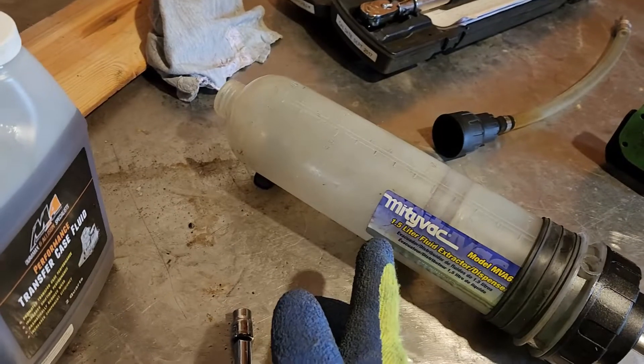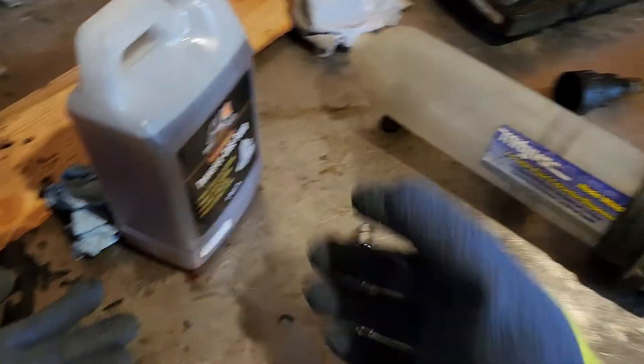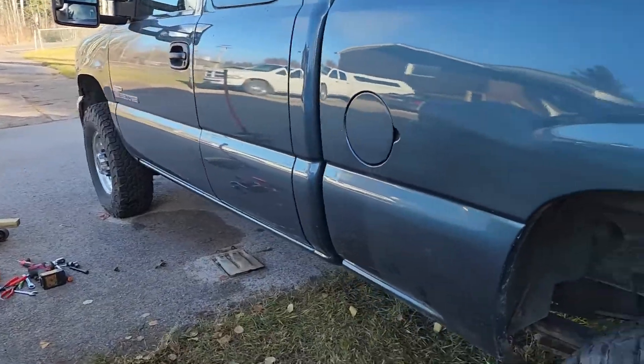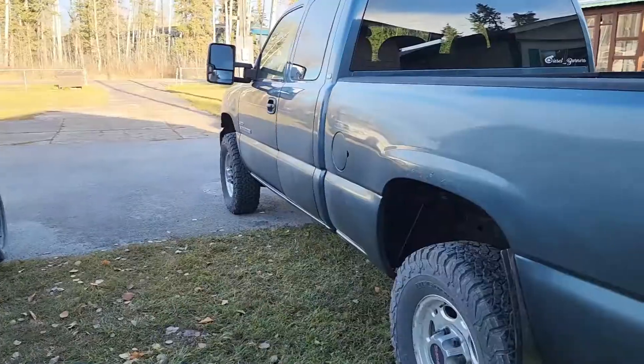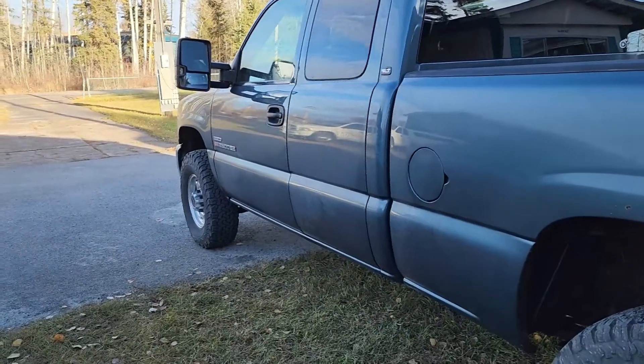I'm filling up the mighty vac - it's pretty handy for tight spots like this, you just put it on the end and push the oil through. We got oil in it, got the fill plug in, now we're gonna let it warm up and go for a cruise. Test drive turned out good - no leaks, fluids look good. I also greased the front end, checked all other fluid levels, and tested my block heater and stick-on oil pan and transmission heater. I'm good to go for winter. Hopefully you guys found something useful in this video and we will see you in the next one.